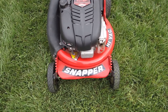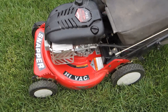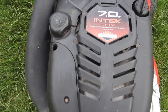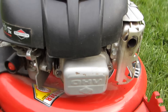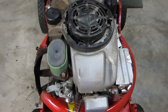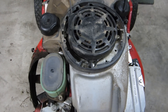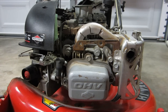I have cleaned the evil twin up and it looks good. I'm gonna do the valve adjustment on it now. I'll take this cover off, check any debris in there, and then take the valve cover off. I'm doing this inside because it's gonna rain any moment. I've got to take the gas tank off and I've already taken the side shroud off to give me access to the cover. Getting all the debris cleaned out before I take this valve cover off.